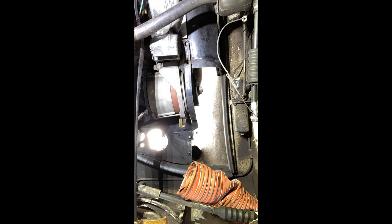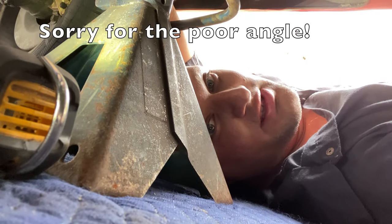Now we have most of our heat exchanger system out of the way. Basically everything but the exchanger itself needs to come off because there is your alternator. You've got a pivot bolt on the bottom there. This front piece of tin is what we're trying to get out. I've taken several of the bolts out from the top but there is one way up here — I'll get some light and show you guys that. Once we get that piece of tin out I can show you where those connections are. We removed the top pivot bolt, the fan from the front, and we're going to remove that 13mm nut right there. Once that's off we can lower it, pull the back cover, and start changing out the wiring.